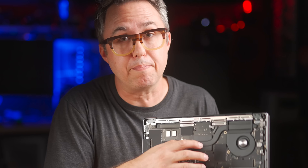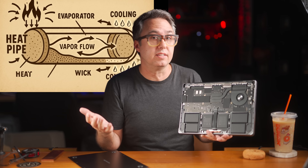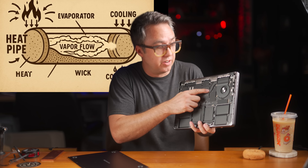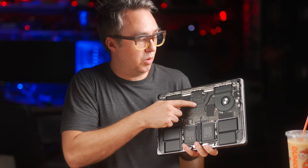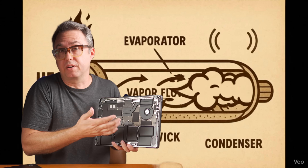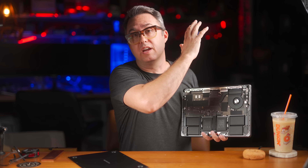It's the phase change into vapor that we're after here. Changing water from a liquid to vapor uses energy — in this case, energy in the form of heat. Since energy never really disappears, it remains in the vapor. That vapor immediately moves from where it's hotter to where it's less hot, over on the other side where the fan is. There's a heat sink under there that pulls the heat off this tube, then a fan blows that heat out into the air. Once the vapor hits the heat sink it cools down just enough to get back below its boiling point, and the vapor condenses back into liquid. That phase change from vapor back to liquid uses the same amount of energy that it took to boil it in the first place — and that's how heat picked up next to the CPU gets delivered to the heat sink and blown off into the air.